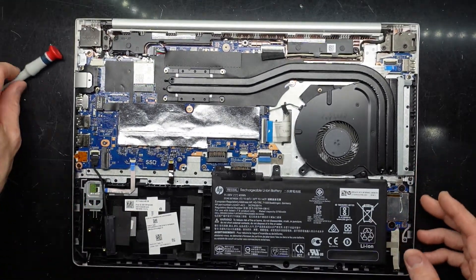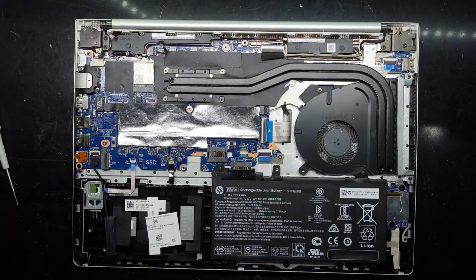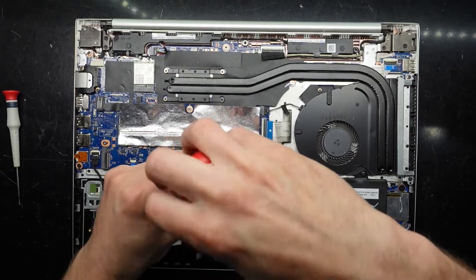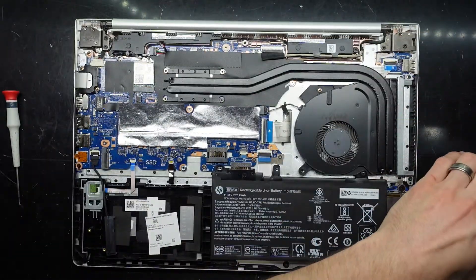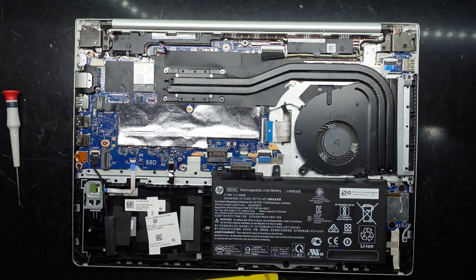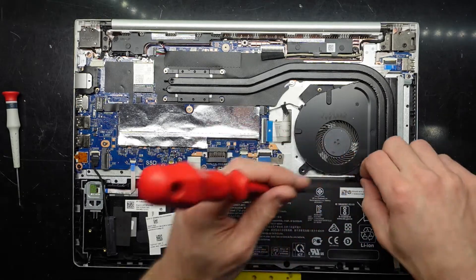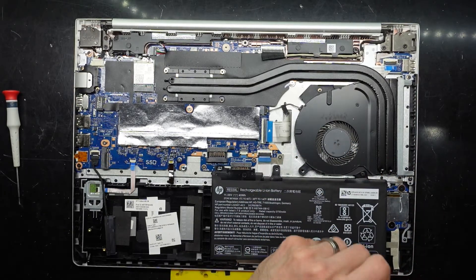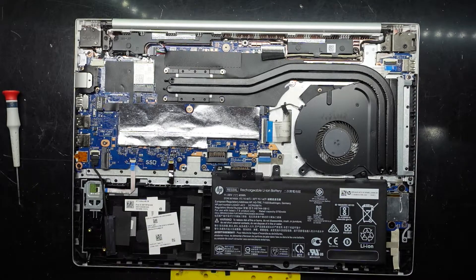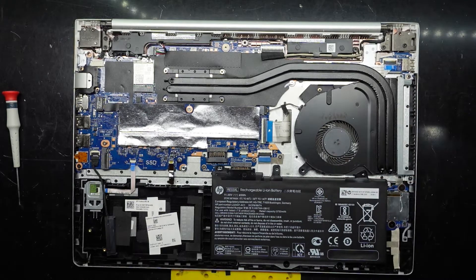You guys are going to follow me along. To begin with I want to remove the battery. Now this one here just has had mainboard failure, so I'm hoping I can simply swap it over and have a good working machine. I'm going to have to disconnect a whole bunch of the flex cables around, and strangely enough I don't have to remove the CPU core.